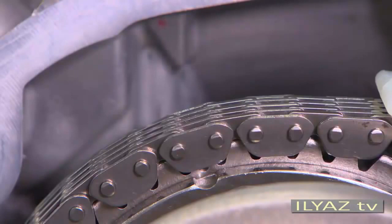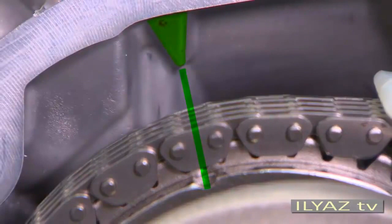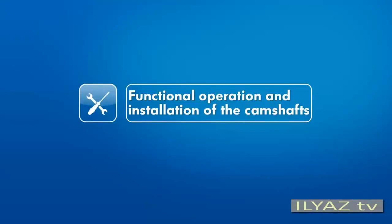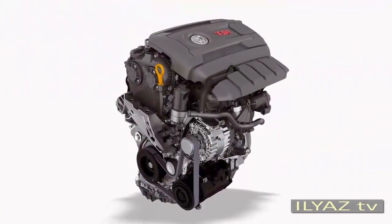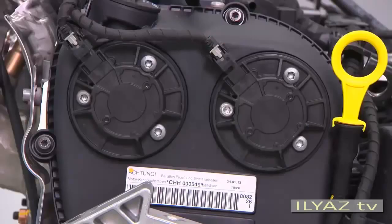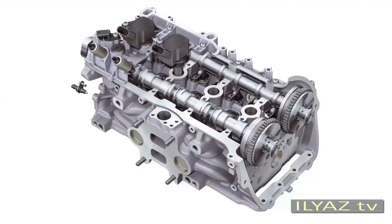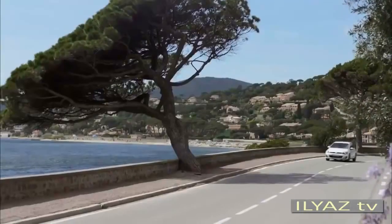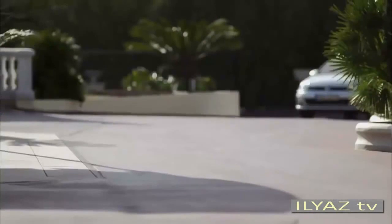The marks on the camshafts and the cylinder head cover must match in the same way. The 2.0-litre TSI engine comes with a newly developed cylinder head. Important new features are the camshaft adjustment and the variable valve timing for the exhaust camshaft. Using the valve lift changeover, it's possible for the valves to open and close via two different cam profiles. The charge cycle in each cylinder is optimally controlled, which particularly improves the charge cycle in the lower speed range.